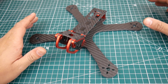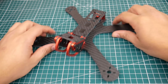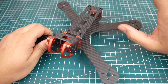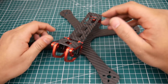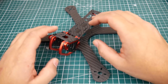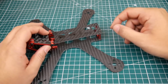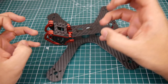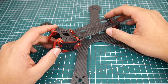Let's start with some of the components that were missing. I was missing a couple of screws, and that's one thing. The bottom plate seems to be very rigid — this thing looks like it's going to take a hit. However, my first impressions were very good but then I started screwing into the aluminum and the aluminum just started melting. You really cannot over-screw into aluminum. They give you longer screws to go in longer so they have a better chance of holding their threads. On the back, the screws go all the way to half — just because the aluminum is so buttery. It's not like any Jeb RC LX5 aluminum here.